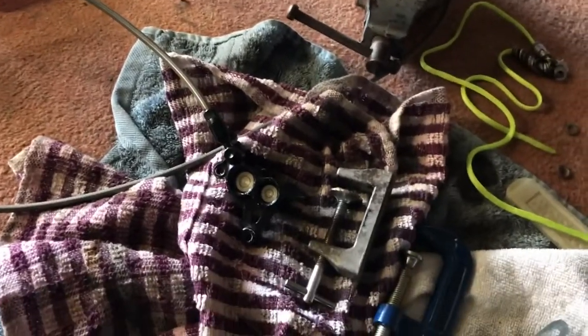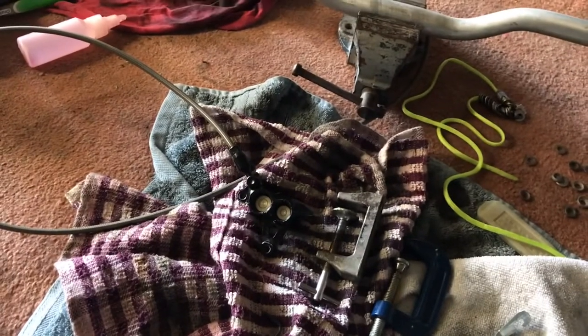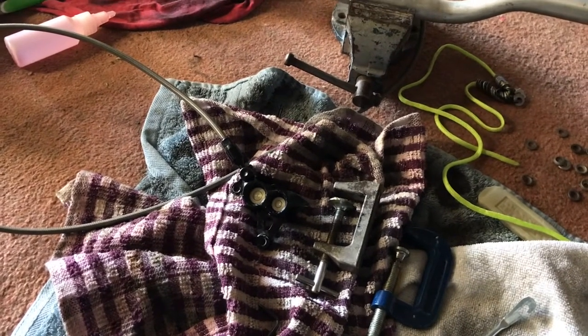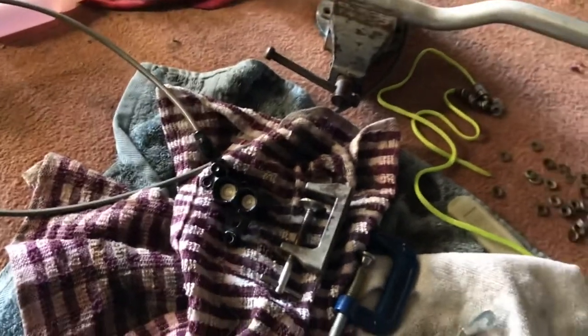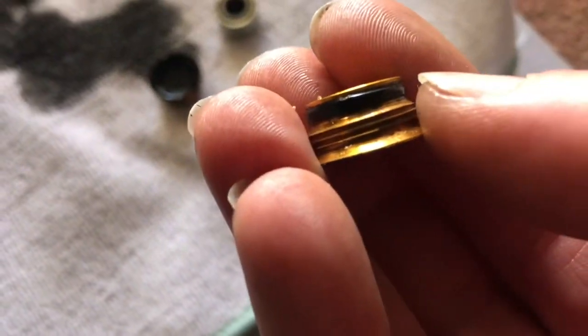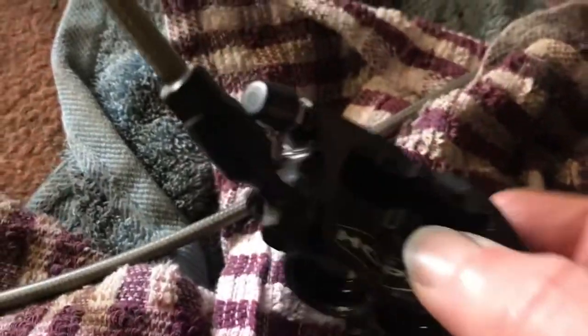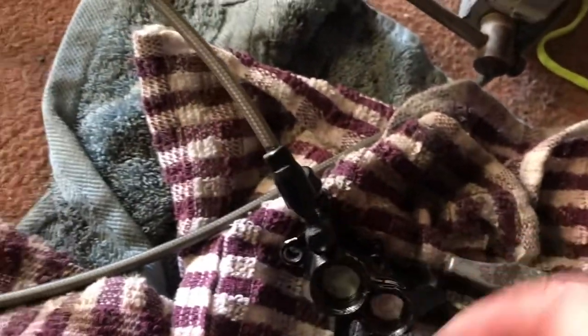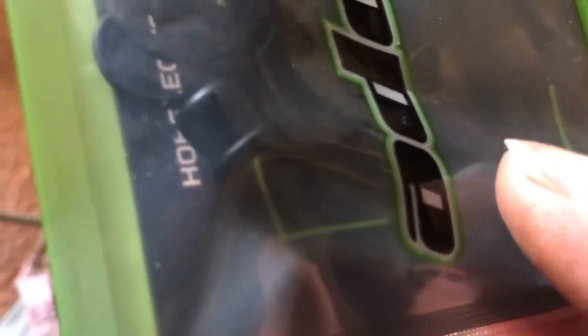They've been totally reliable. Gave them a few bleeds. It really works like this - when you've bled them and all the air is out and everything's running sweet, you needn't really touch them for three or four years at least. I'm going to check the seals and probably keep those as spares. We're going to put the new ones in. They give you some cap seals, a couple of o-rings, and then for each piston - one, two, three, four seals in there.